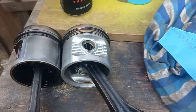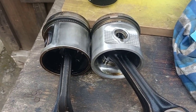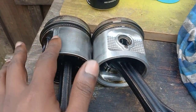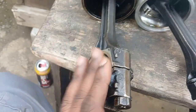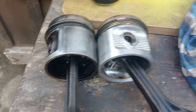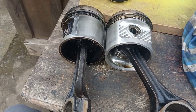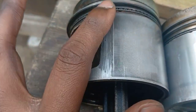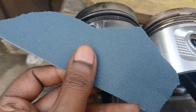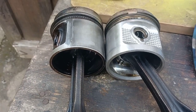I know it's not ideal to not re-bore the block, but I know the engine has more miles to give me. The best thing I can think of right now — it's pointless re-boring it to a 20 thou — I just wanted to make sure the bearings were fine and physically see the condition of the pistons, that's why I stripped everything. If it were very bad I would remove the block straight away, but I don't think we're going to have any engine seizure while driving. So I'm going to give this piston a light rub down with 220-grit sandpaper and show you guys how I install the piston back inside the bore.